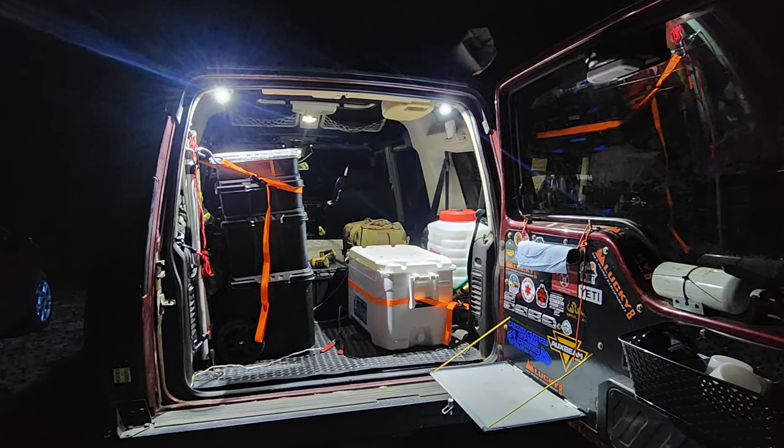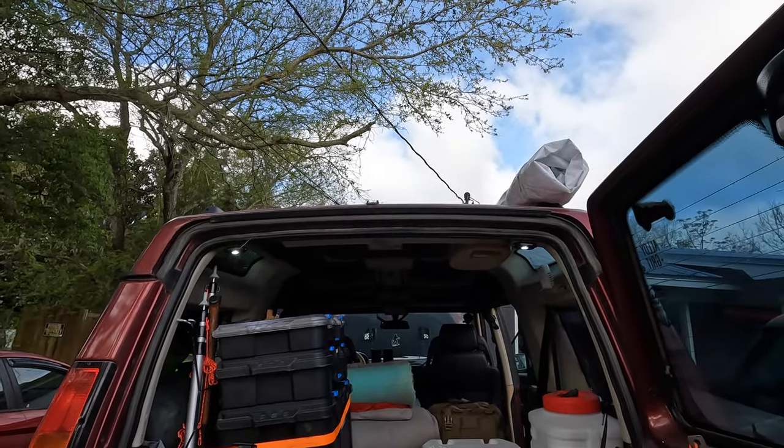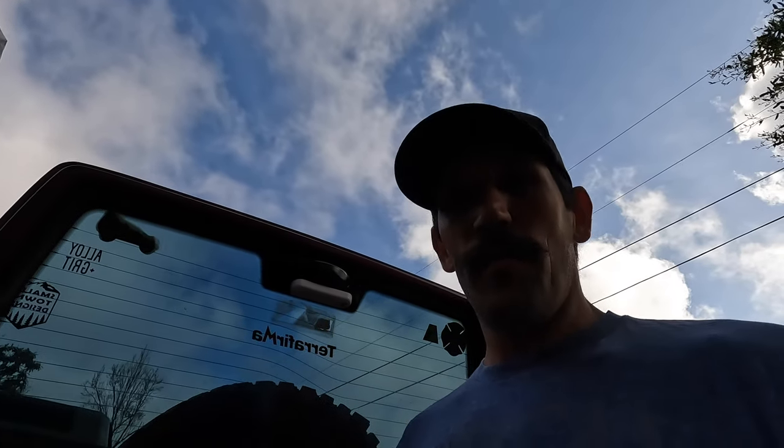So I installed these cool little lights from my buddy Wally - I'll show you pictures at night, they are super bright and light the whole area up. They're running off the accessory battery so I can just leave them on all day long. They're only pulling about half an amp each, so even with all my LEDs on - camp lights, rock lights, map light - I'm pulling like an amp and a half to two amps total. This setup lets me charge all my cell phones and camera batteries while sitting at camp without having to have the key in the ignition. That's the biggest reason I've done all this - so I'm not going to bed with the key on the accessory position and waking up to a dead battery.